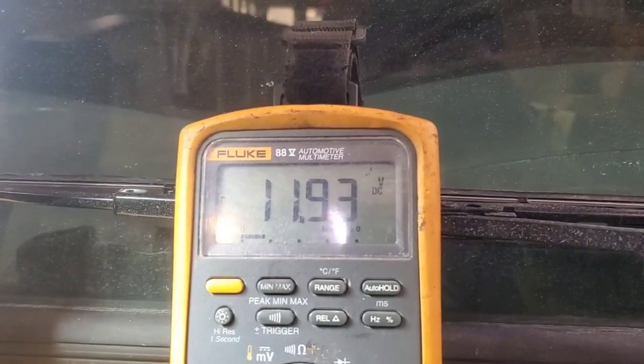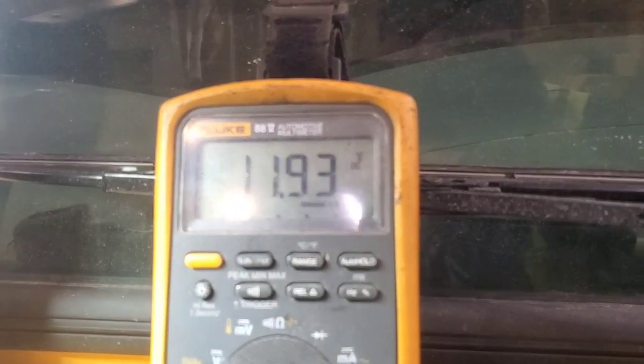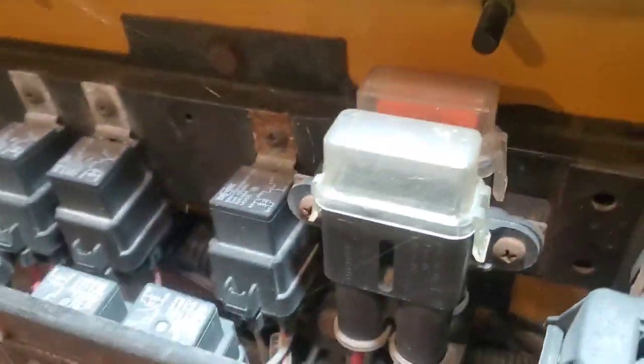Quick tip to make sure you got a good ground: put your ground up, connect your meter to voltage, and just load it up real quick. Yeah, it's a good ground. We're reading just below 12 volts because this pump is running. So I'm going to go ahead and remove this relay and test the main voltage at it.